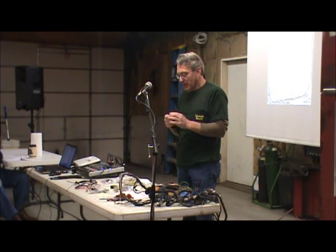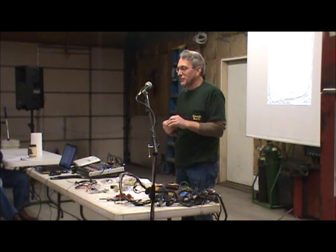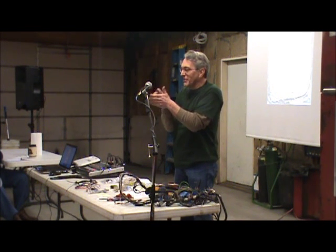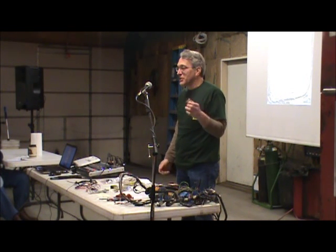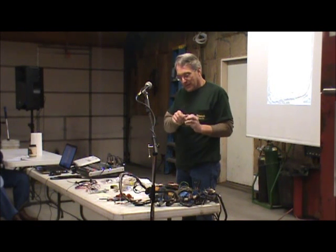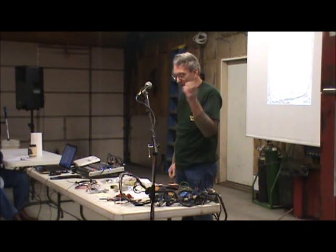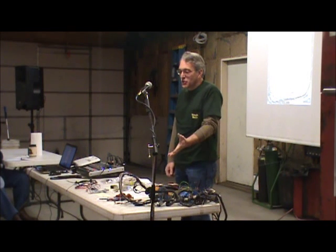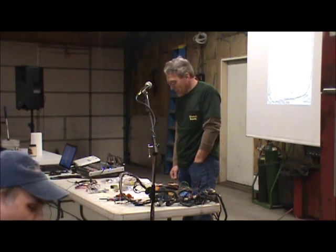So there's no true interface, it's just two pieces of metal touching each other. Well, after a while, you get a little layer of corrosion in there, and the headlight works or doesn't work, but as you drive the car, the parts are kind of rubbing against each other. Eventually, they start to come back on. The easy fix here is you go to Home Depot, you buy a $9 soldering iron, you scratch this little connection in here where the two sort of come apart from each other, just scratch it, solder that joint together, and it will work forever. It's just stupid junk like that that makes us chase issues all day long.